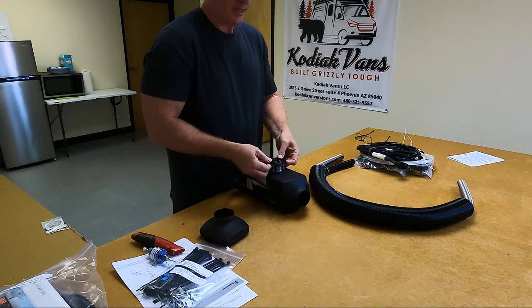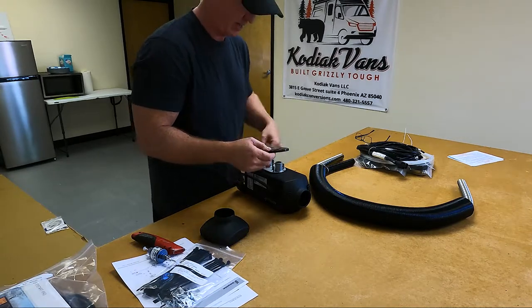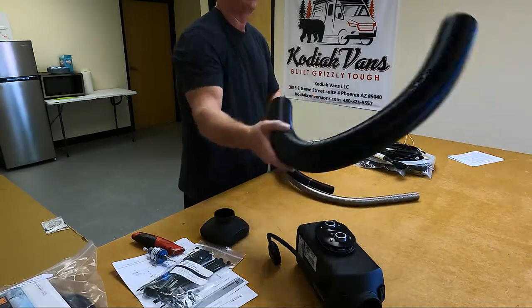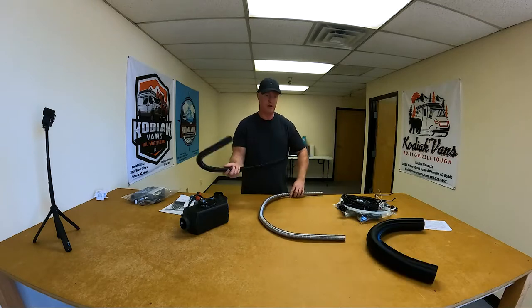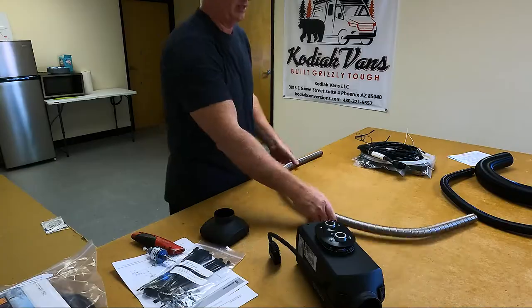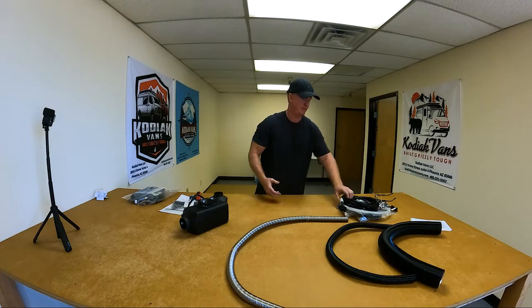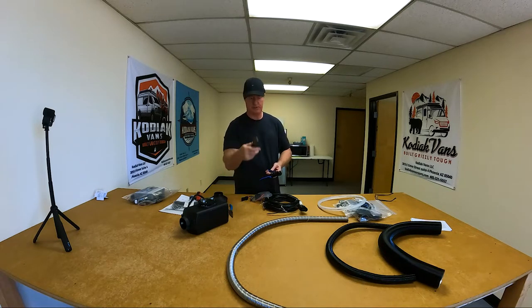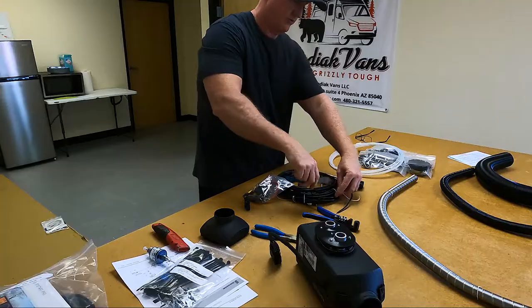This is your gasket. This will be really helpful when you want to mark the area that you're going to drill inside the van under the seat. You really don't need to measure underneath the van — I'll explain where the main cross members are that come through underneath your seat. So here's your blower tube. We'll end up cutting a bunch of this off because you won't need that much line. And your exhaust — we'll end up cutting about a foot off of this just to go from the muffler out to the exterior of the van. I've got a few common household appliances with the exception of this — needle nose pliers, trimmers, and a little wire stripper tool. Let's go through all these wires.